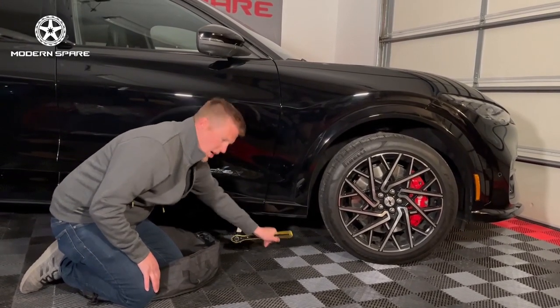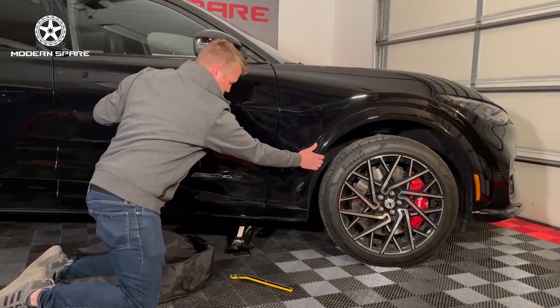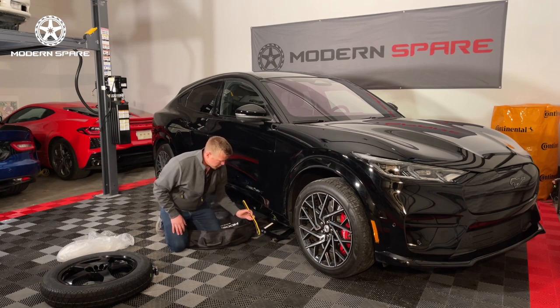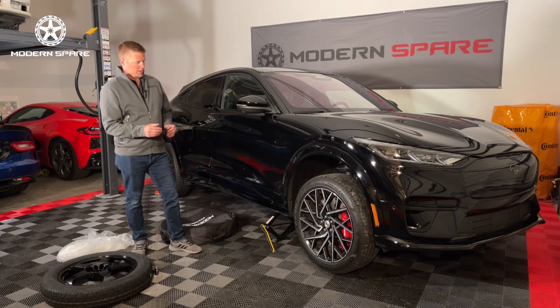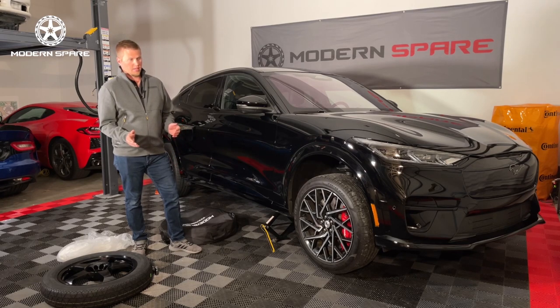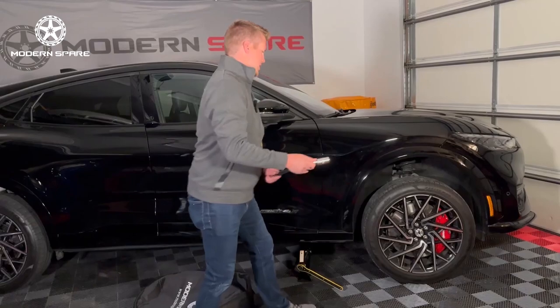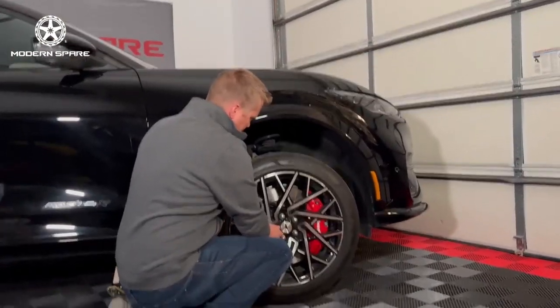Once you've got it lifted up a little bit but maybe not quite off the ground, it's not a bad idea to take a close look underneath and push the vehicle slightly — rocking it around — just to make sure it's stable and you won't have any problems once the vehicle is suspended. Then keep working at getting the tire off the ground. We are now ready to pull the tire and wheel off of the vehicle. It is very important for safety that at any point the jack is supporting the weight of the vehicle, you do not place yourself or any part of your body underneath the vehicle. Since we've already loosened the lug nuts, at this point it should be fairly easy to take them off.